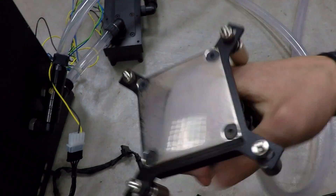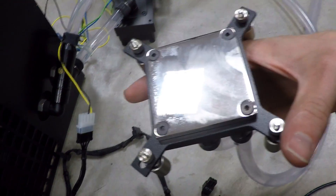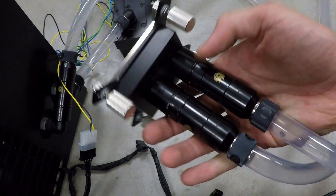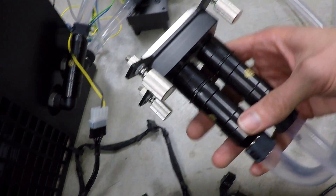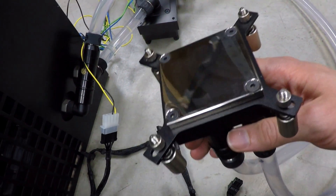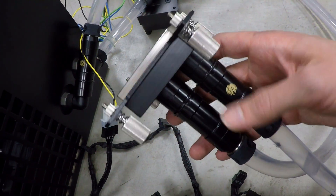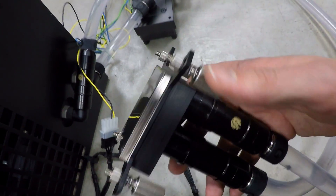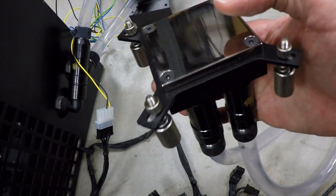This is the CPU block. You can see when I just blow air on it you can straight away see there is a little bit of water on it — that's because of condensation. The water inside is really cold now, around 9.5 degrees Celsius, which is the lowest I can go here because we have around 20 degrees Celsius room temperature. That's the lowest point I can hit with this chiller.